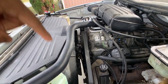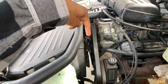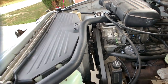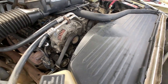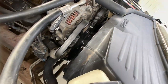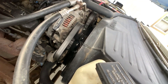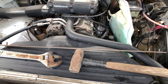The hardest part of this, if you haven't removed it before, is actually removing that clutch fan because there's a big nut in there. In order to remove it you have to hold on to the fan, which is the hardest part. A lot of people use different methods — there are like 100 different methods to get it out. I have a kind of homemade bar to stick into some holes on that crank to hold it in place.